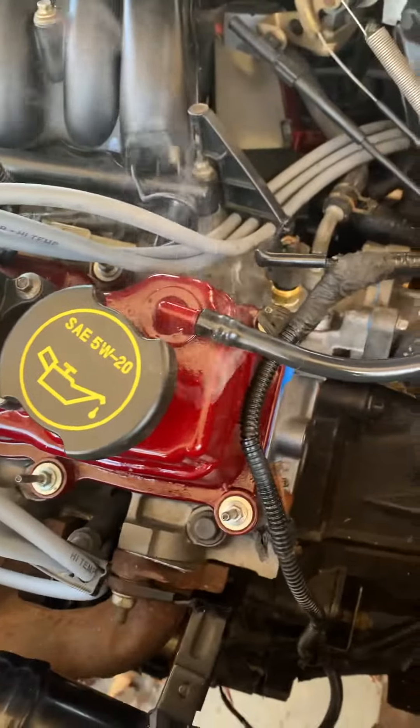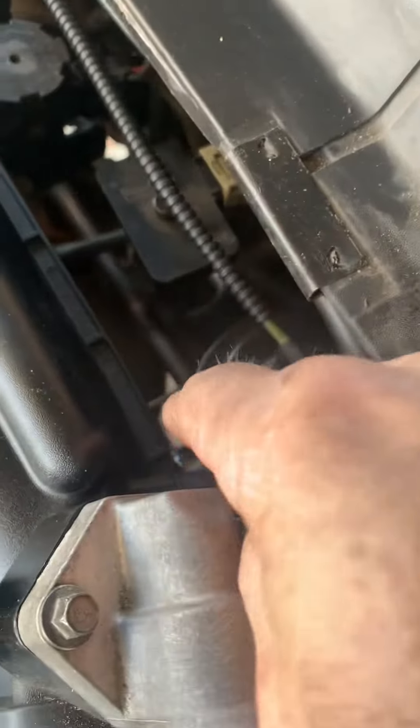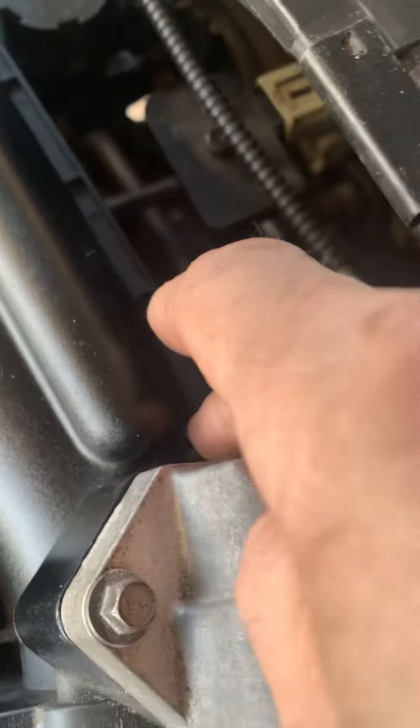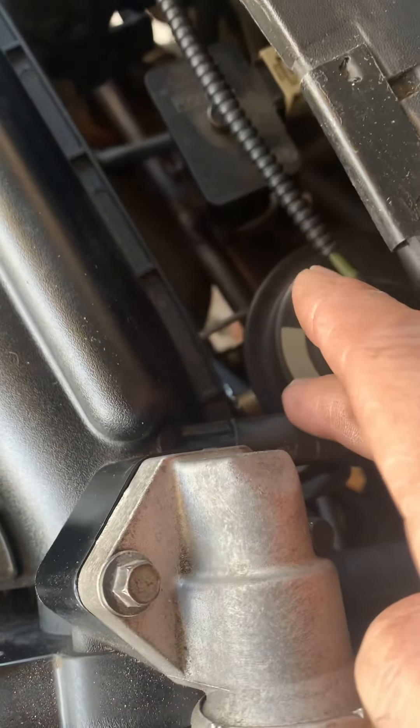I did find that I have a vacuum leak here, and one that I already corrected was back here when I put this thing back together. I'd put new heads on this. There's a hose back here coming off the back of the upper intake manifold — I forgot to connect that hose.